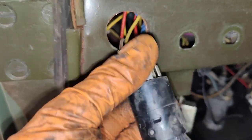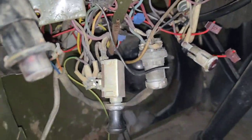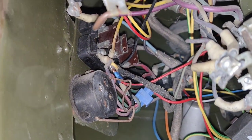As much as I wanted to ignore it, I knew the wiring on the van was in a poor state. I was going to ignore it for now, get it up and running and maybe revisit it in the future when the van broke down on me, no doubt. But the more I look, the more horrendous it is - lots of twisted-together wires. There's a crimp that's just uncrimped, lots of scotch clips, twisted wires, and this is what I guess qualifies as a fuse box: just fuse wire wrapped around some Bakelite. Never really seen anything like that before.